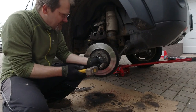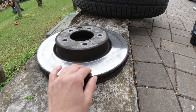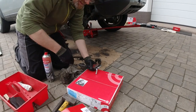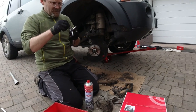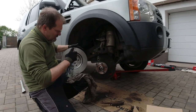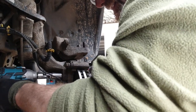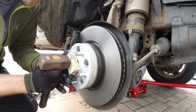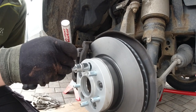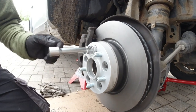Working on the second side now. It just needs a little bit of a smack. Missing a lot of material — are they actually more worn out than I thought? Brembo is the Italian brand. Installing the new disc — turning it counterclockwise until it snaps, giving it a zero mark, counting: one, two... eleven and a half revolutions. So this is for sure good enough.